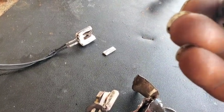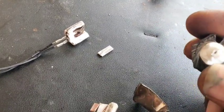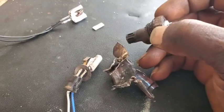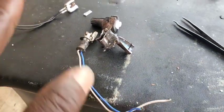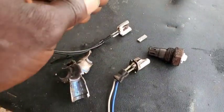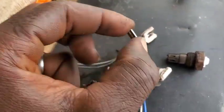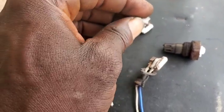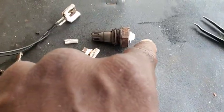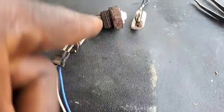So it has a heating element on one side of this same little chip, which is in the center here. And on the other side it is the sensor, and it has a hole in between that protrudes down to the O2 sensor tip, which you're seeing right here. It is really, really magnificent — it plays both roles. That little chip, which I've picked up right now, is inside giving feedback to the O2 sensor, protruding all the way down to this section here.